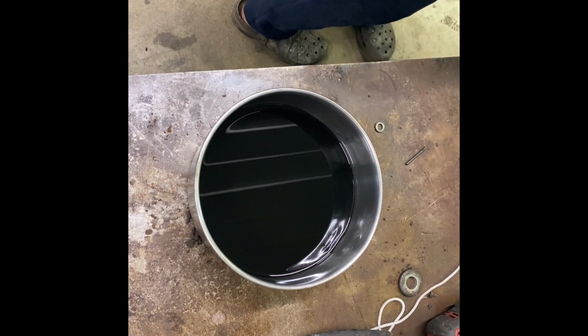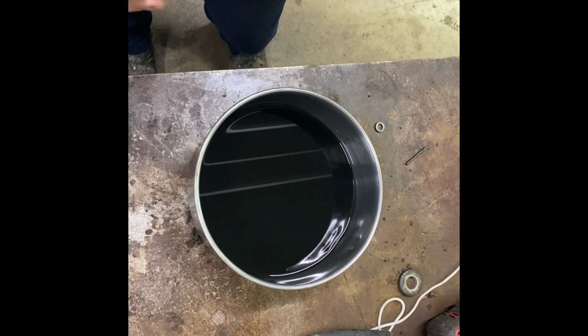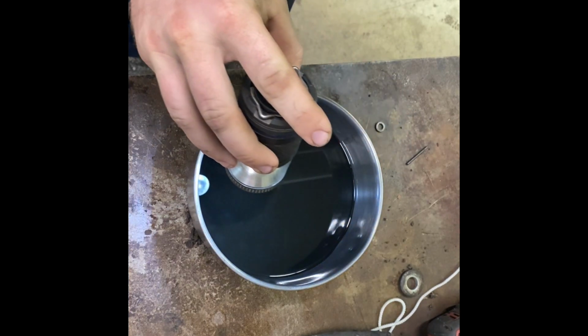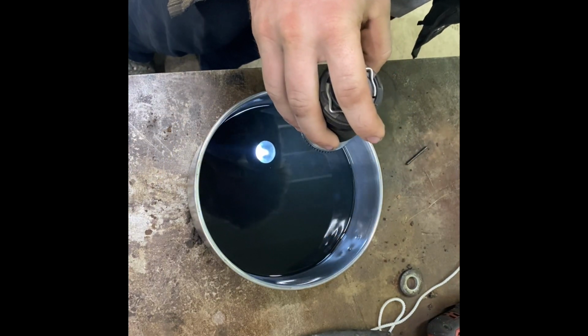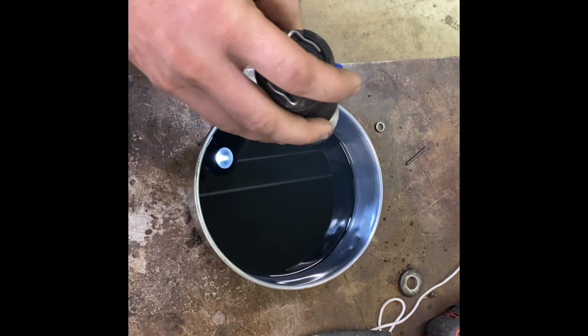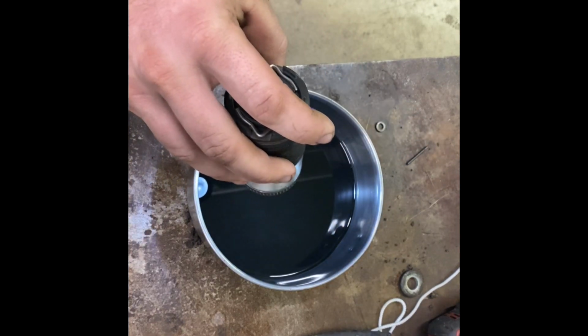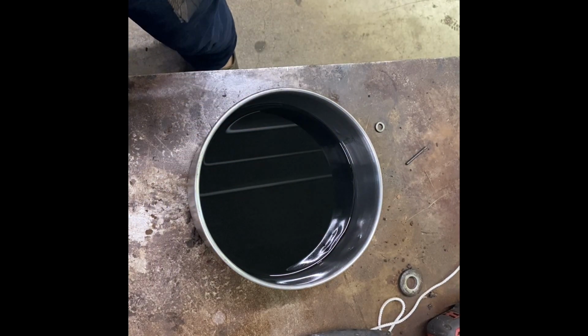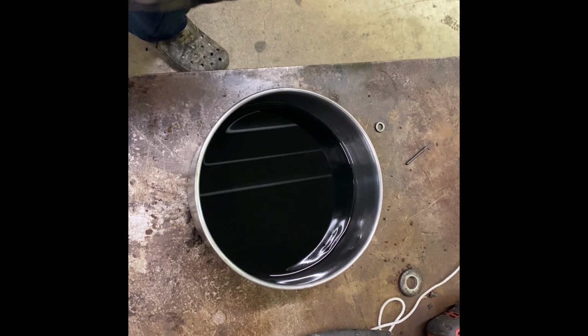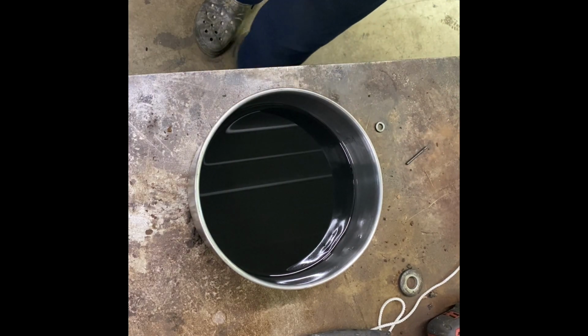So here's the oil from that 316. I finished draining the tractor, so we'll see what it looks like. I don't really see a lot that's alarming to me. I see a little bit of cloudy over here. However, that's not terrible. It's barely anything if you look at it. I don't see a big metal rainbow anywhere. Now, I would expect to see a little bit of metal in there, especially since that is, as far as I know, the original oil that I put in it when I rebuilt that motor. I'd expect to see a little bit from it running and breaking itself in. So that should be fine. I'm pretty happy with that.